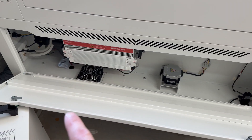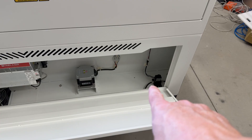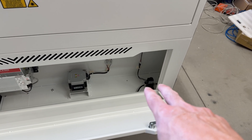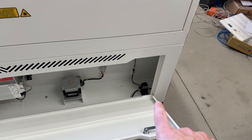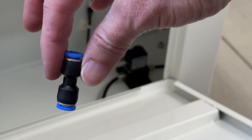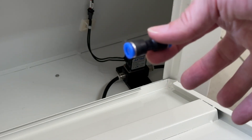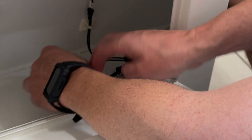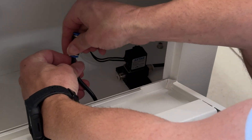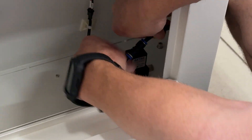This is the left side of the machine. You open up this door — this is where the RF tube is. Right there is the original air solenoid that we are going to disconnect the lines from and bypass. We need to grab the six-mil to six-mil connector to make this one line. Press on the ring and pull out on each hose, then place the inline connector in between. It should look just like that.